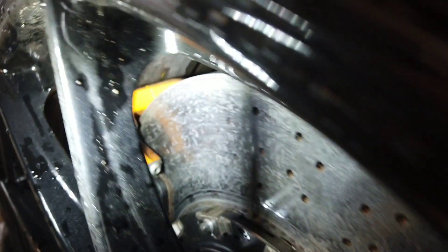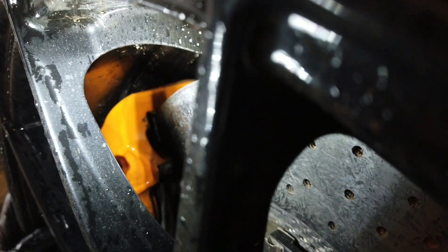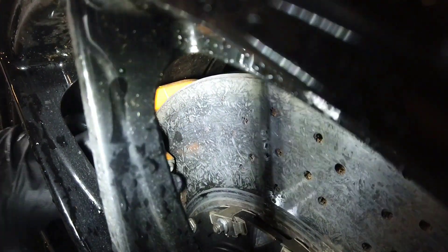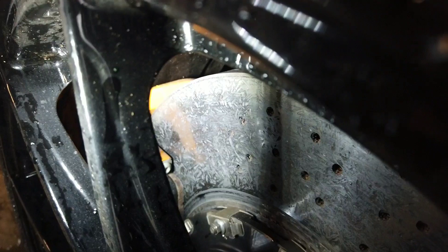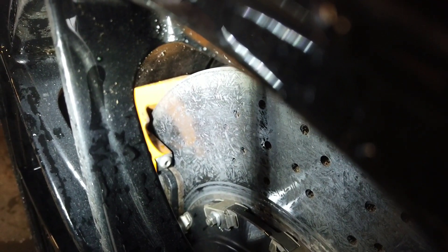Brakes. In this example we're looking at CCBs. The only real way to measure them properly is to weigh them, which isn't practical at a track day, so a visual inspection is always needed. Run your finger over the disc — not too heavily, because it's carbon fibre — it should be relatively smooth to touch. If it's really roughed up you may have some issues. Check both sides, and also check the wear on the pads — there should be a decent amount there.